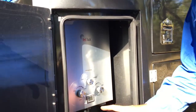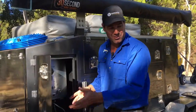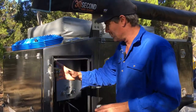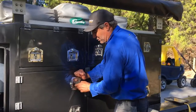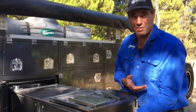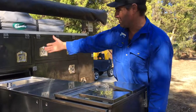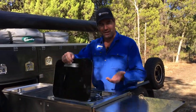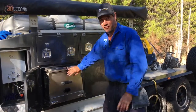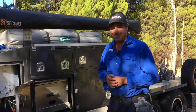So yeah, it could have caused a fire. The hot water system was connected to the gas, so you could even shut the door while the thing was working. Imagine all those flexible fittings — any of them could have leaked into any of these lockers. We've got batteries and all the rest of the stuff in there as well. The hot plate was also connected so you could just pull it out and start using it, but again you've got all these flexible joints with pipes all joined, so any one of them could have been leaking inside the lockers. Imagine just shutting it up and there's a slight leak on one of the flared joints — it could just fill the whole thing up. Very dangerous. That's probably why he didn't get a compliance plate and couldn't get it over the pits.